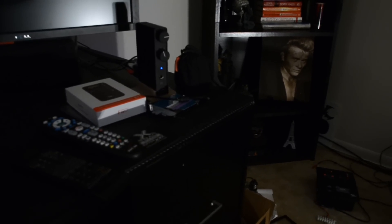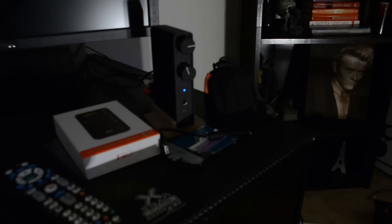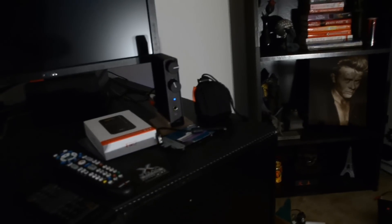Hooking one of these up, you're going to have a lot of options available to you based on your setup. You could go directly from your video game console, directly from your stereo receiver, your TV, whatever you're going to be doing — a splitter is probably going to be used in some way. My options were: go from my DAC and use the headphone out, split it, wear headphones and run the other to the amplifier; or go from the stereo receiver and use the line out to run to the amp; or split the pre-out from the DAC and run that to the amp. I went with the third option because I can control the volume independently off the DAC and boost the volume going to the amplifier without even having to turn on the stereo receiver, giving me a bit more independence.